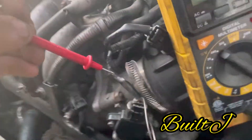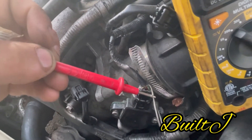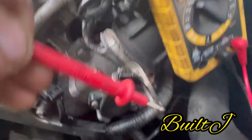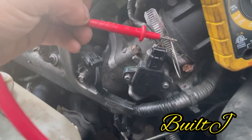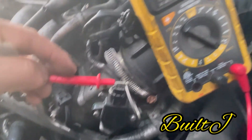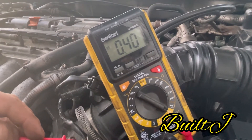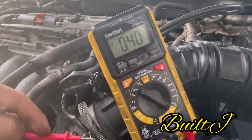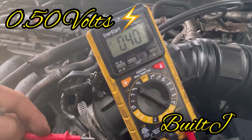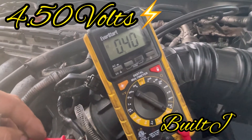This is the reason I use the key ring — as you can see it's circled — so go ahead and touch it with the red terminal off the voltmeter. Look at your voltmeter: that is 0.4, so that is about 10 points off. It should be at 0.5 at closed throttle, and at open throttle it should be at 4.5.